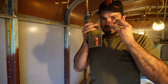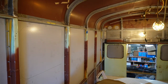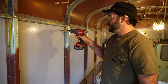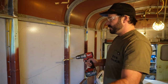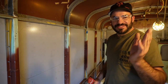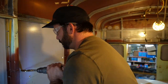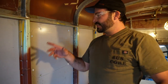The first thing we do is grab a drill bit — I think this is actually a 5/8 inch, but it just needs to be big enough so that you can get your jigsaw blade in and get that started. Half inch would probably work just fine. I like to do two holes on each corner — one at the start and end of each radius. I find that gives me options to get the saw in there just the way I like. All of our holes are done and we now have access to get our jigsaw in and we can start making the cuts.